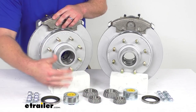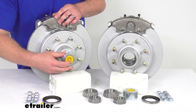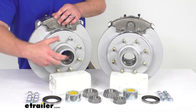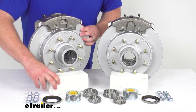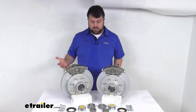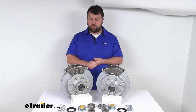This system is lubricated with grease, so you'll have your inner grease seal and an Easy Lube grease cap with a rubber plug that can be pulled out. If you've got an Easy Lube spindle, you can just pop out that plug, hook up your grease gun, pump some grease in there, and make sure everything stays lubricated — very easy to maintain. Note that grease is not included, so you will have to provide that in addition to the brake lines and actuator mentioned earlier.